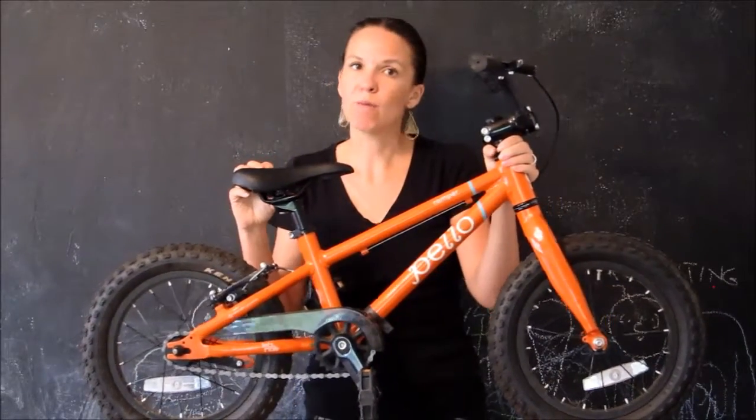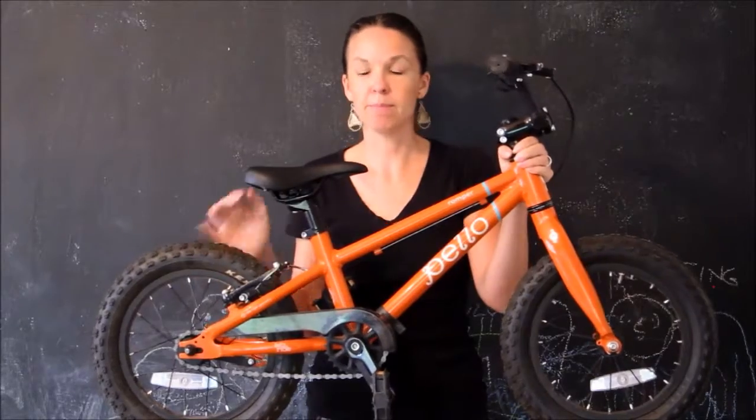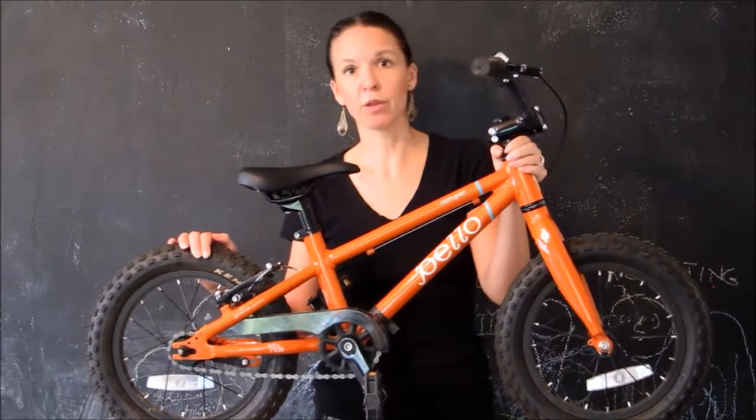The other thing to note when talking about brakes is the rear coaster brake. In the United States almost all bikes are sold with a rear coaster brake, and it's not my favorite. It makes learning to pedal a little bit harder — kids back pedal and they end up stopping. Also, if we're talking about taking this bike to the pump track or on single track, that coaster brake can actually be a little bit dangerous because they end up skidding out. I would have preferred if Pello had an optional freehub. Some bike companies are offering that now and it might be something Pello is able to look at in the future.